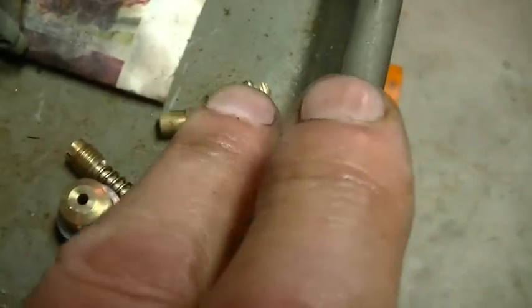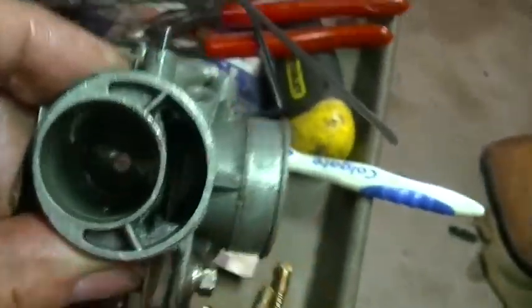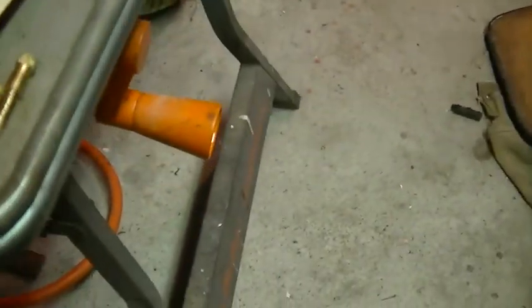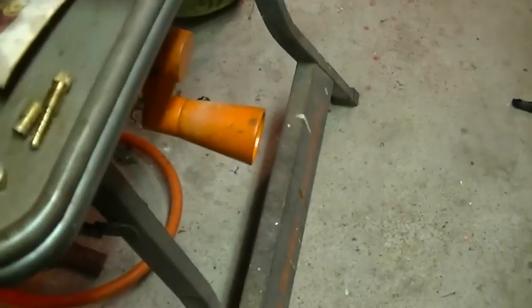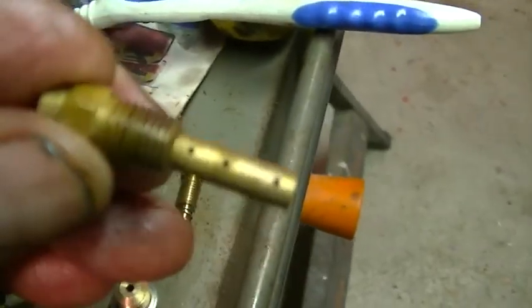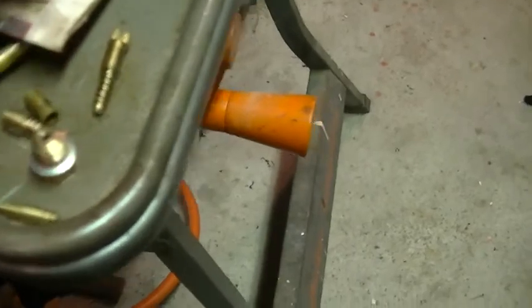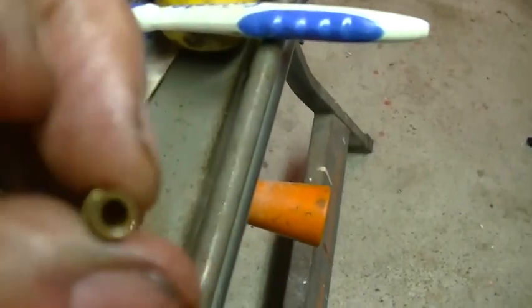The only thing I didn't show is a main nozzle, which is down where this chopstick is — I use that to pop them out of the center there. On some bikes they're more like an emulsion tube, almost like a jet. They fit up inside there and those get clogged wicked easy. But this one I wasn't sure what it was like, but not much can happen to it. We'll clean it anyway.